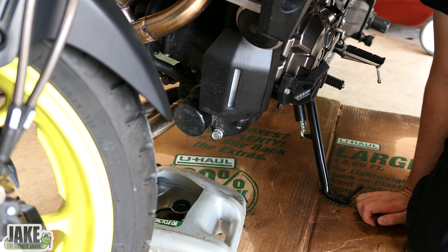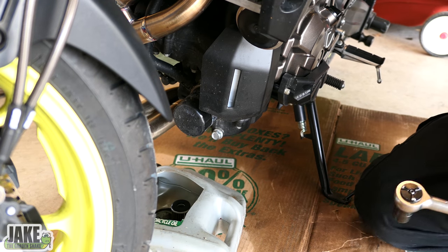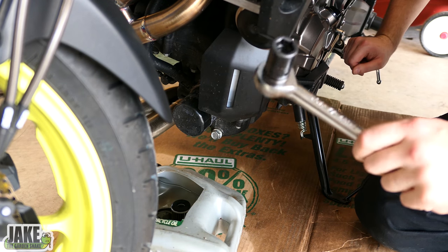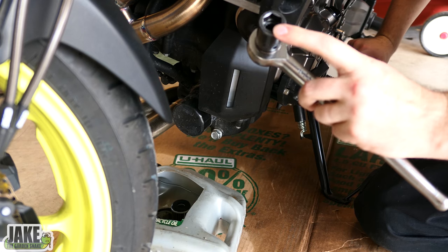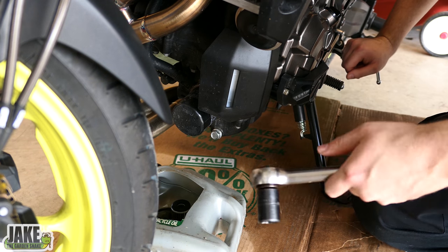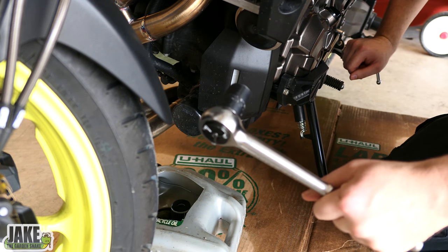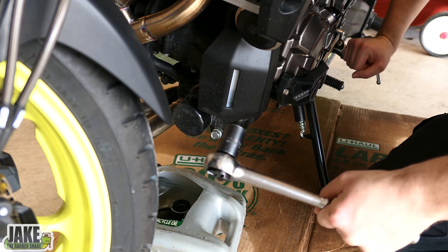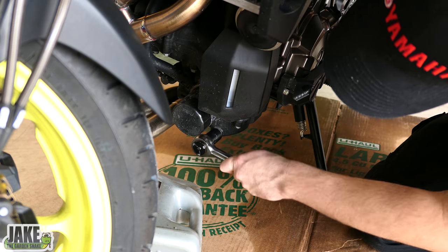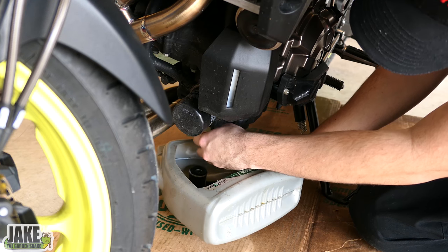The drain bolt is literally right here on the very front of the motor. I've seen people say they hate how Yamaha puts the drain bolt right there in the front — you're going to smash it on something. What they don't know is almost every bike with a fairing has the same thing. I'm using a 17 millimeter, and I like to use a six-sided socket. The only 17 millimeter six-sided I have is an impact socket, so I have to use this big wrench, which I'd normally tell you not to do, because when people see big wrenches they tend to crank down on them. You'll see me when I tighten it — I'll be holding it up here for a reason. You could put gloves on, but it's supposed to get dirty.